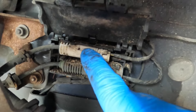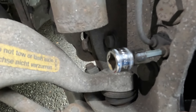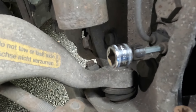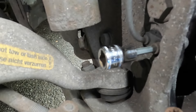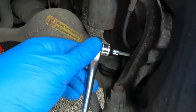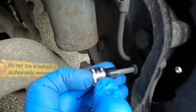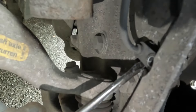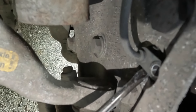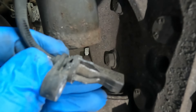The one above is the brake pad wear sensor. The sensor is held in place with a 5mm allen key bolt. It's really important that the allen key is seated correctly — we really do not want to round this off. In reality, this actually came undone really easily. I gently used a flat-bladed screwdriver to ease it free, and with some gentle wiggling it came out.